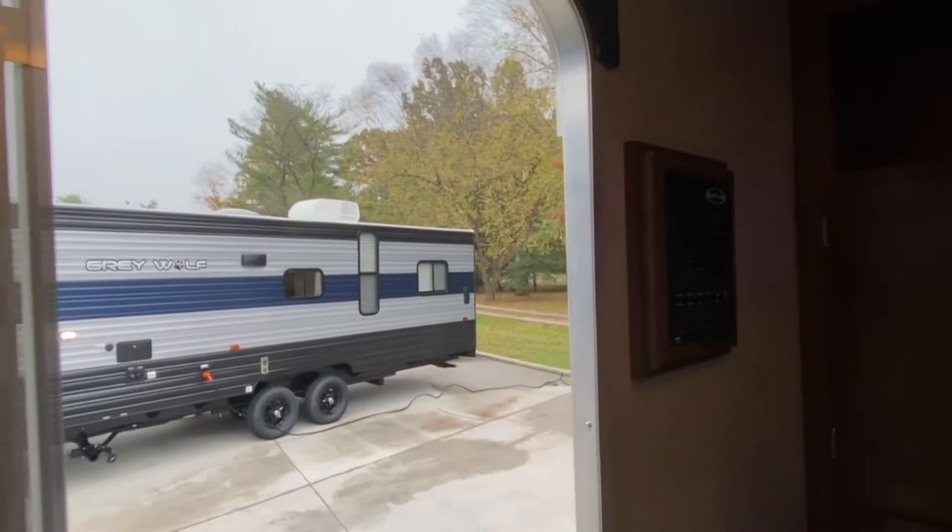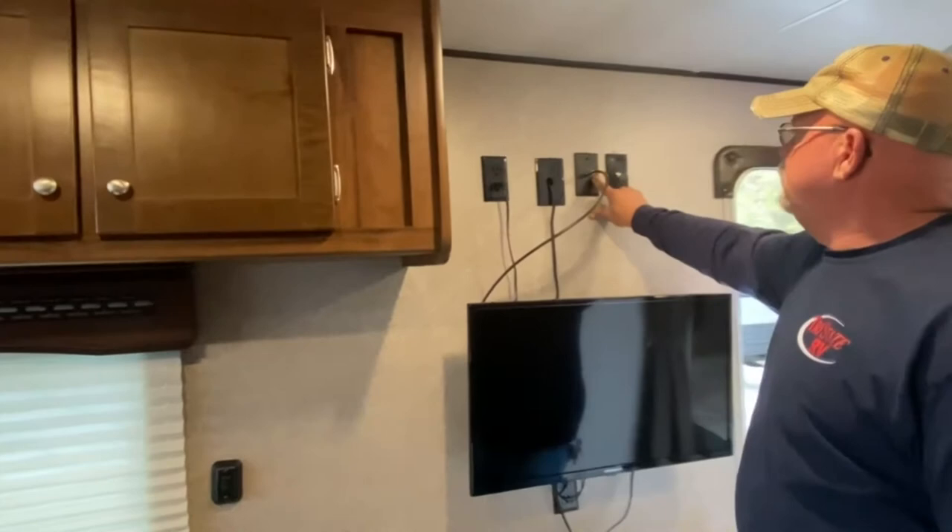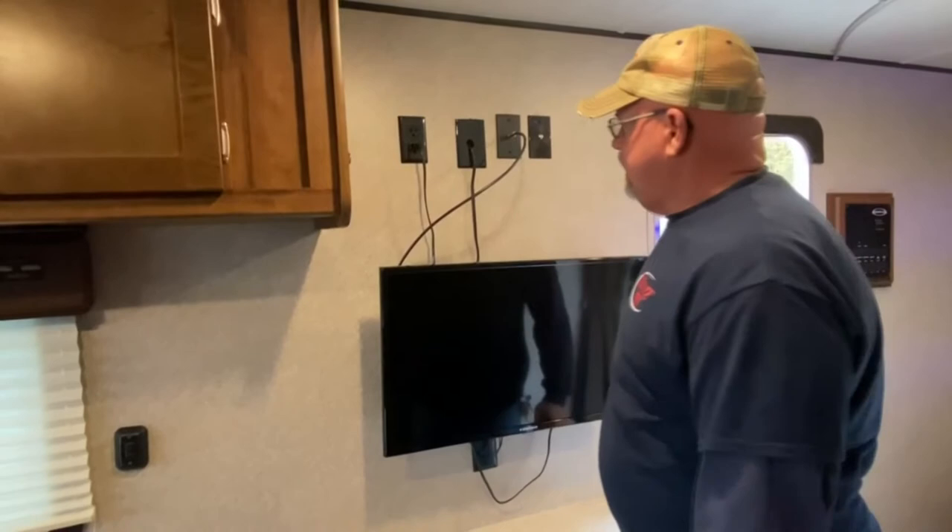On the back side of the TV, this is where you'd hook up to your antenna on the roof. It is a digital antenna. You'll notice the green light here — that is a booster for the antenna, which helps you get a signal. When you power your TV up, you scan in your local channels and that's what you have. This would be for that satellite hookup. If you hooked the satellite, you'd go into a receiver and then into the TV.